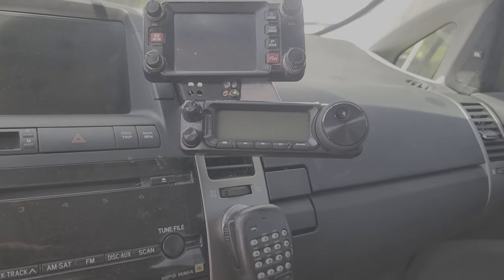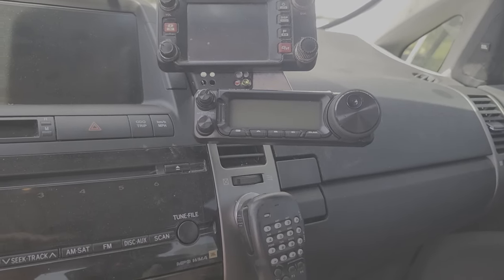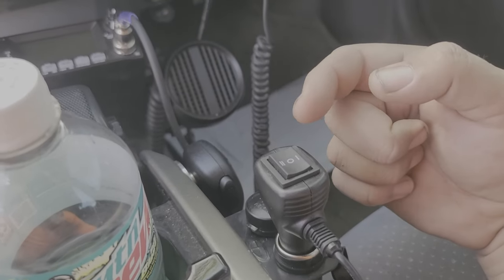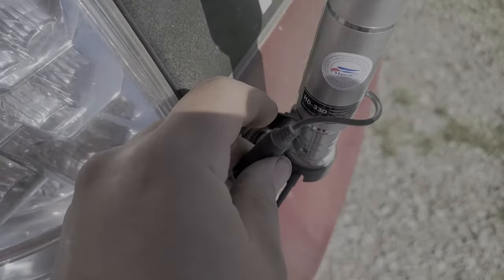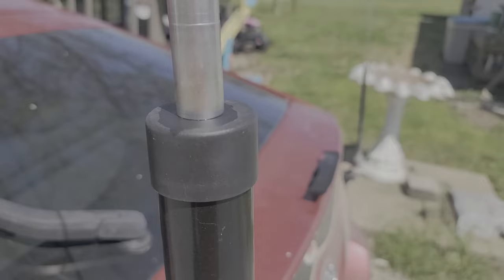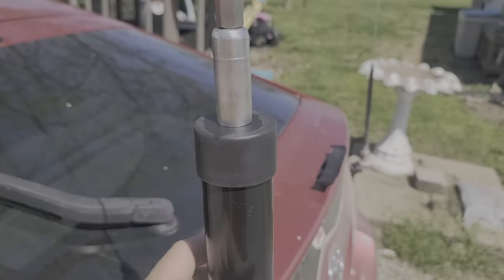Once you get used to running it up and down, it does have some sweet spots, and once you're in range it's fairly easy to fine-tune. Ray had gotten rid of the stock plug and put in a little momentary switch — I have one, I just haven't got it installed yet. The cable is run through the car and comes back out to here; it has a plug so you can unplug it, take the set screw off, and put the antenna away if you're going somewhere.